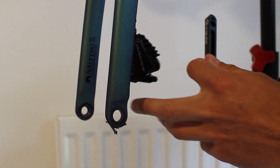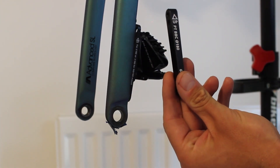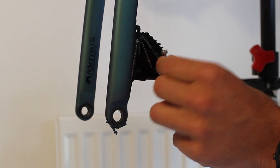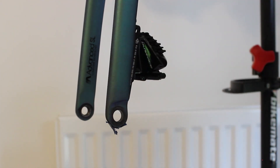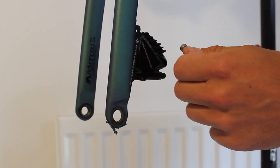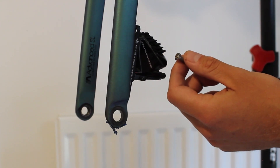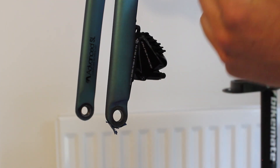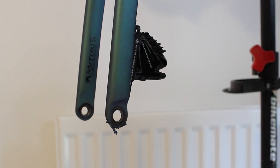We actually utilize the existing 160mm adapter which piggybacks onto my adapter - just like the Shimano one, it tells you which way is up. It's installed to the flat mount part of the fork with M5 by 12 Torx low-head fasteners. They're low-head for a reason because they won't fit if you use anything else. I chose Torx because a normal low-head M5 socket head cap screw comes with a 3mm hex, and 3mm hexes are very easy to round off. A Torx is a lot harder to round off, you get a much better bite, and most cycling multi-tools will have a T25 - so that's a T25 Torx fitting.